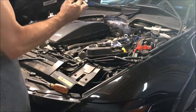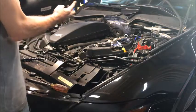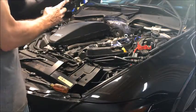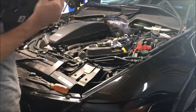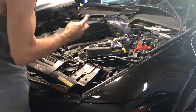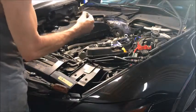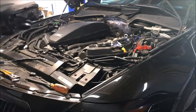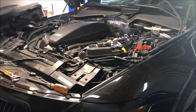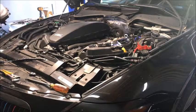Looking at the side — this is the little one I just last took off, and this is the first one I took off. That's where your air comes in. In the back there's one that's plugged off, and then there's one that's connected — that one is the dangerous one. You can see the little connector back in there. If you break those little lines you have a lot of work to get to the back of the engine.